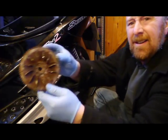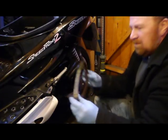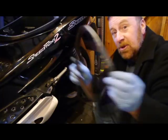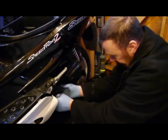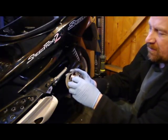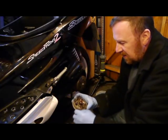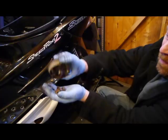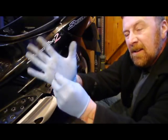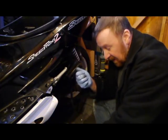Look at the state of that - very dirty. The belt actually looks quite good. Can you see the shape that's been left in it? That tells me this is an old belt - although it's good, it's old. Let's look at the variator - a bit stiff straight away. Something I've noticed: there are no little guides in here - they should be in there. I'll show you some in a minute. Look at the rollers - they weigh about three grams. Can you see guys? Look how dirty they are.